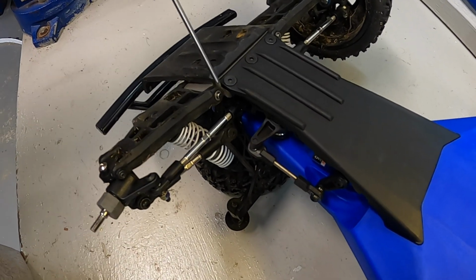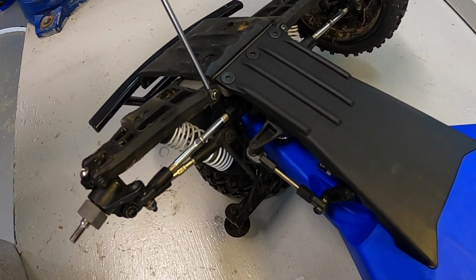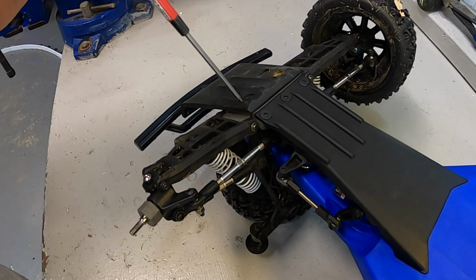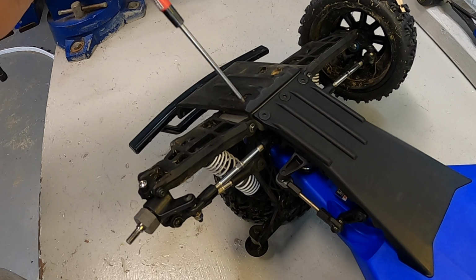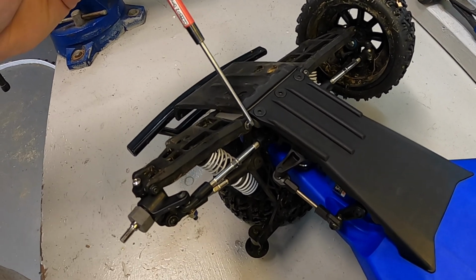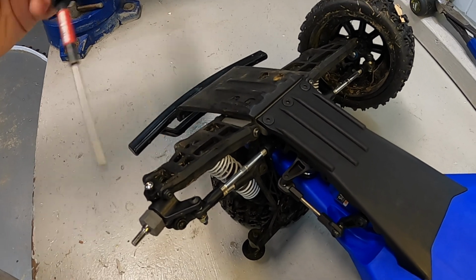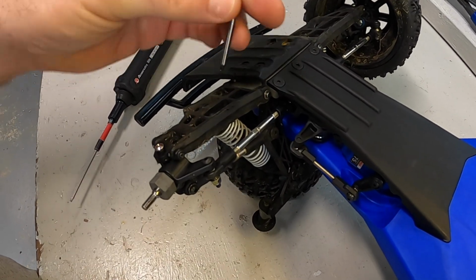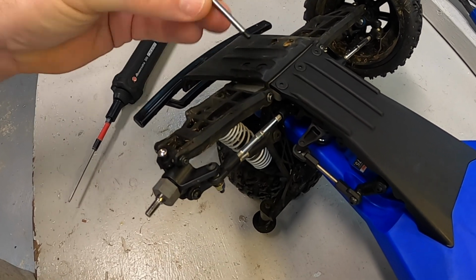And what you can see is the front is actually currently with some E-clips, both front and rear, and a solid shaft. Honestly, that's probably just fine, and it'll do just fine. Yes, with a big enough impact, you can bend or pop an E-clip out, and then you can start to lose that shaft. Yes, going to this is still definitely a better choice overall, so I'm going to go ahead and do it.